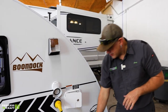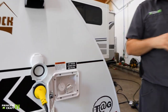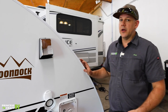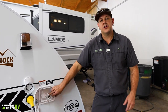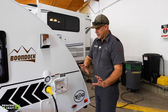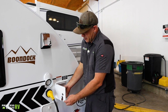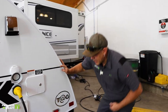You do have another access step here to get up to the roof. Behind our 110 power cord we do have your water connections. On the left is going to be our fresh water fill — the potable water we can carry on board in the fresh water tank and use the water pump to extract. To fill that up, just put your water hose into the port there and fill it up until it backwashes at you. The connection next to that is going to be for our city water connection — hook up your water hose and water pressure regulator here. This campsite is rated at 50 PSI for this trailer so we don't cause any damages. It has a little flap you can move out of the way to route your water hose in there and make your connection.